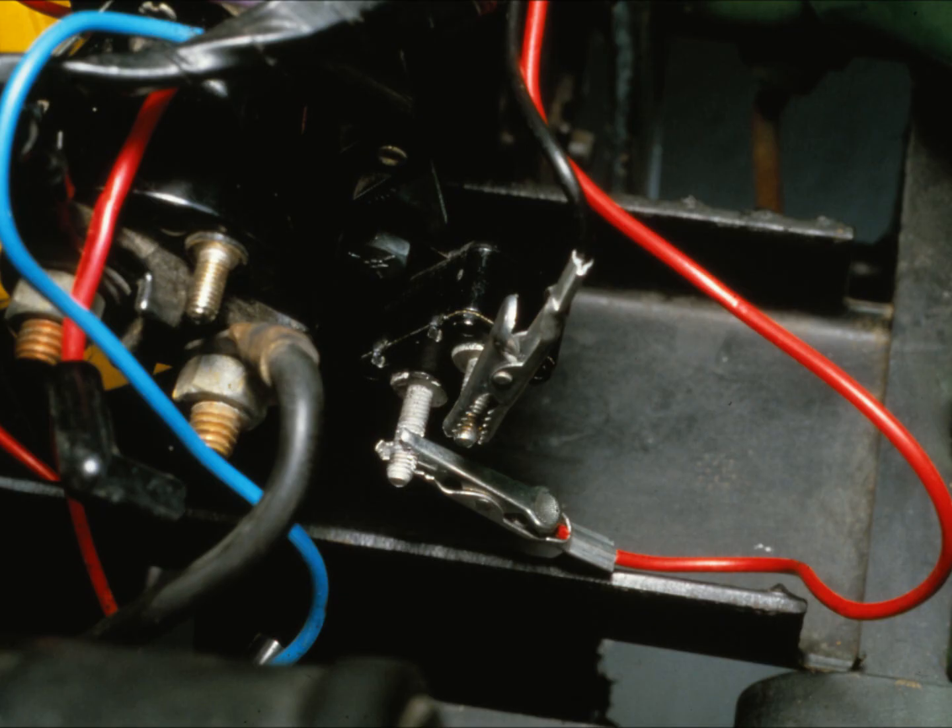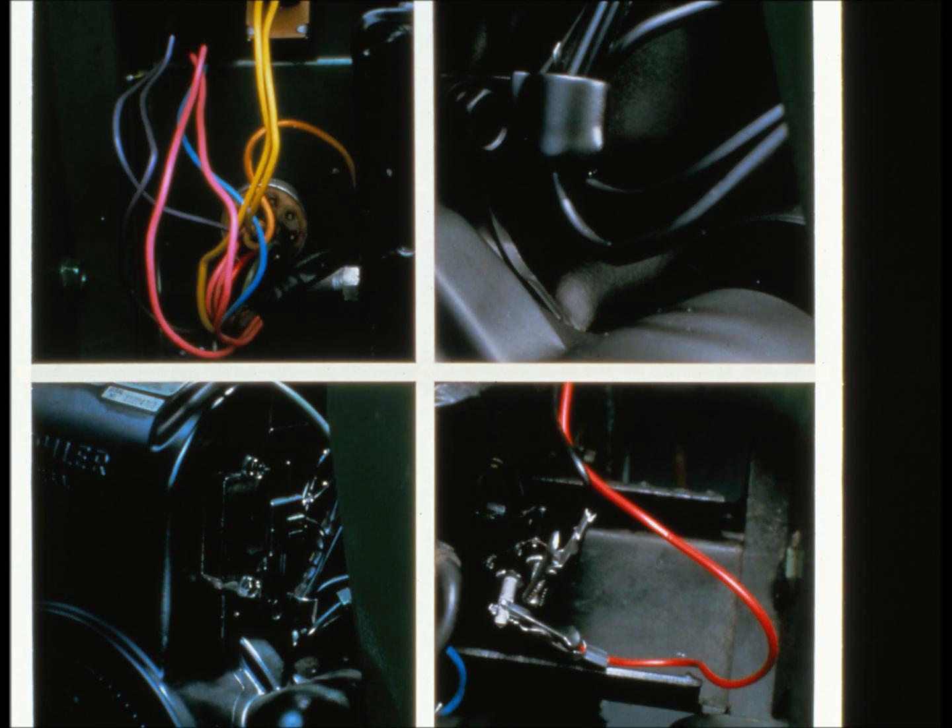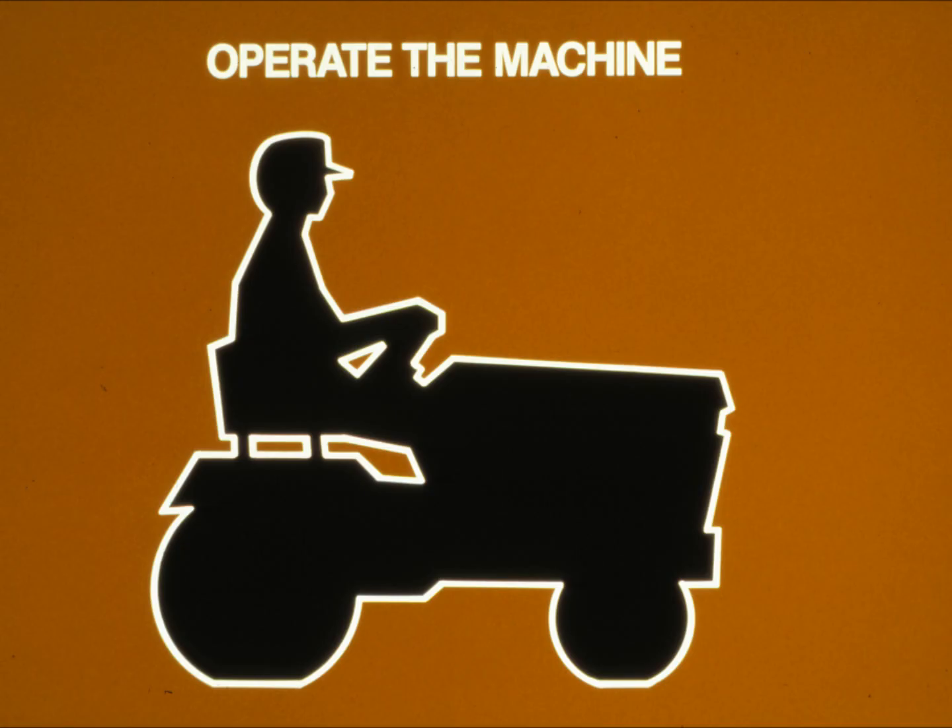Take a look at the rectifier regulator — is the box cracked or broken? Check the terminals for looseness or corrosion. Use a continuity light to check the circuit breaker; the light should go on when you touch the two terminals. If it doesn't, you have to replace the circuit breaker. By fixing loose connections and broken wires and testing the circuit breaker, you will eliminate most possible causes of problems in the charging system.